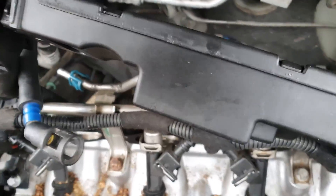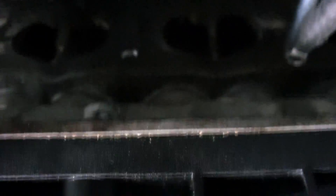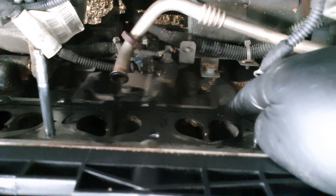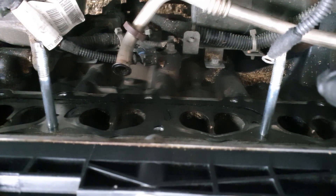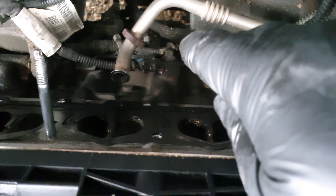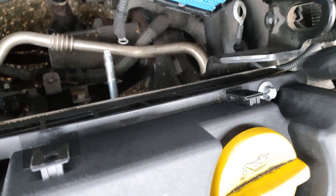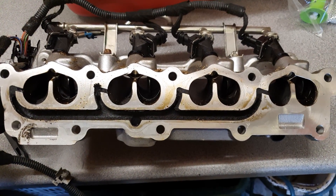The good news is the manifold is now free. I've got the inlet manifold off — or the bottom half of it — we've already seen the top half. You can see the studs it was mounted on there and there, and then the rest of these holes had the torx screws in them — you can see how tricky that was to get to with the manifold in place, hence using the little mirror. This is the EGR pipe that goes up to the EGR valve up there. We'll probably take that off and give it a clean at some point while we've got all this apart.